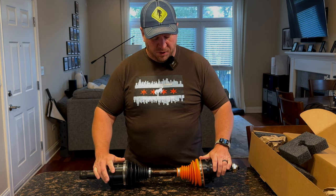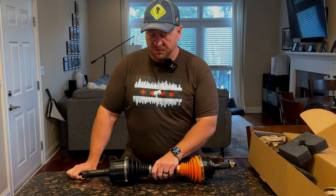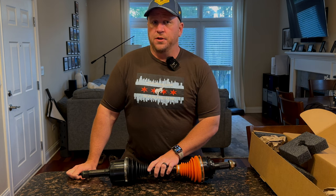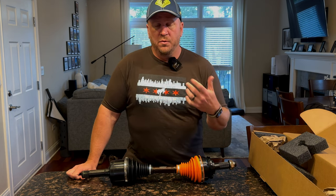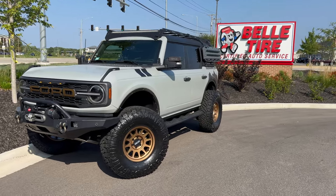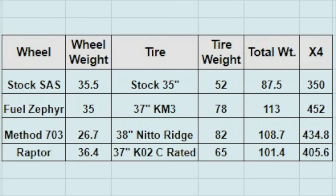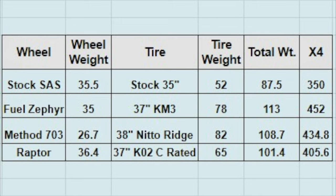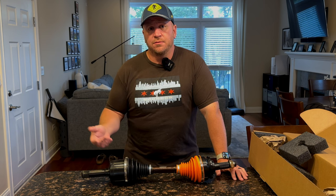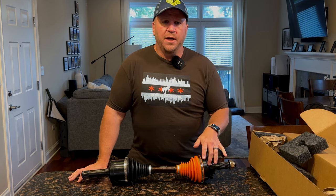These haven't been put in yet, but they have a good reputation in the industry for very strong CV axles. The website says there's a lifetime warranty on tires up to 40 inches. We recently upgraded to 38-inch Nitto Ridge Grapplers, which are a hybrid tire — C-rated, so not as heavy, but still a bit of added weight to the drivetrain. So rather than risk breaking one of the factory M210 axles that comes in the Sasquatch and Badlands models, like ours, we decided to be proactive and upgrade.